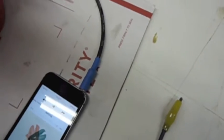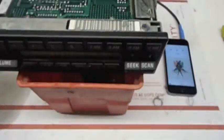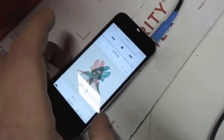I got my iPad hooked up to my 3.5 millimeter audio connector, and I got it in, it's my iPhone. I have it in music, and I got a song. Another thing that came up was, why is it quiet? Well, the signal that comes out of your device is usually low voltage because it's meant to connect up to headphones or earphones or whatever, so the voltage signal is low because the power requirement isn't very high. So if you're playing music through your device and the audio through the car isn't very loud, and you have the volume turned all the way up, then likely you have to just turn up the volume here on the device. So here I can, down there you can see the scroll bar maybe moving.